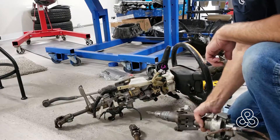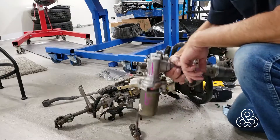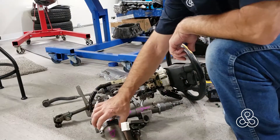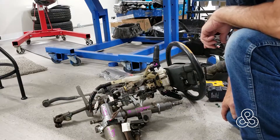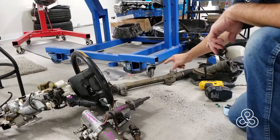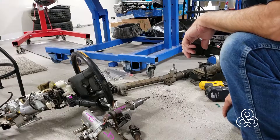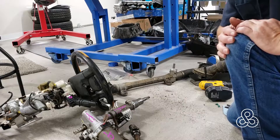I need to adapt this steering column — I need this to actually fit as close as I can, shortened to keep that distance the same. But I need this electric assist unit out of a Toyota Prius to fit in, and then behind that, got a steering rack from the Prius as well. So I've got to make those things, machine the drive shafts, and weld the pieces together to make a complete steering assembly.